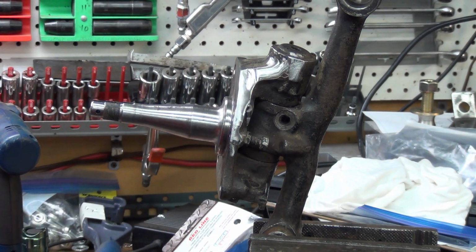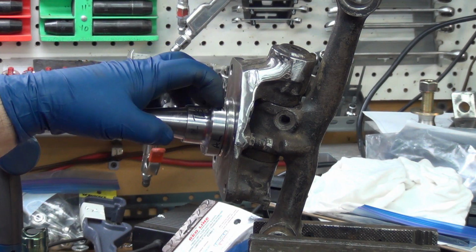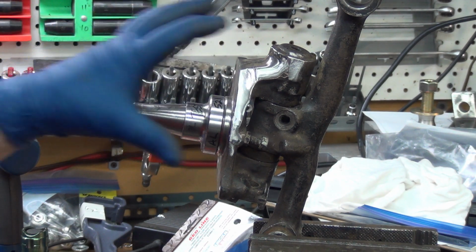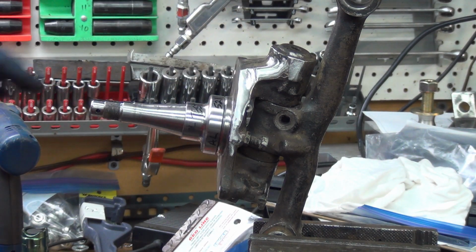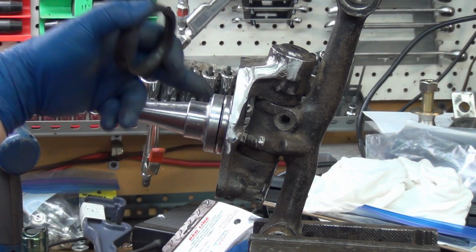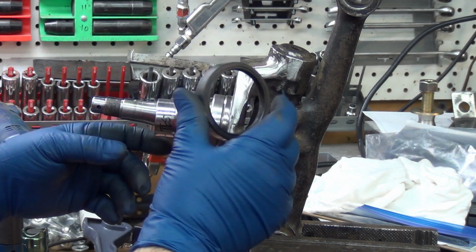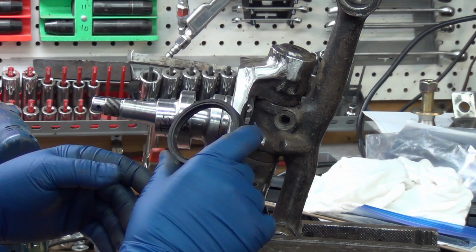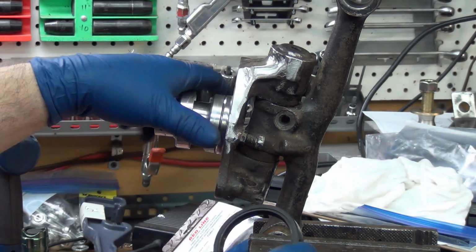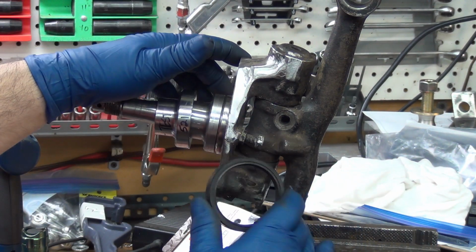So what I wanted to check here was the Toyota 5-lug hub. What are the possibilities of it going on here? The 521 bearing adapter is too tall, and for my brake kits I shave 80 thousandths off the backside to keep everything at the same distance from the spindle face here. So this should be one for a 620. I have the diameter of this adapter for both the 620 and the 521 set for a 79 620 wheel seal. It's a 54 millimeter inside diameter. Outside is 65 according to this, and it's 13 millimeters wide. That's what the numbers on here tell me.